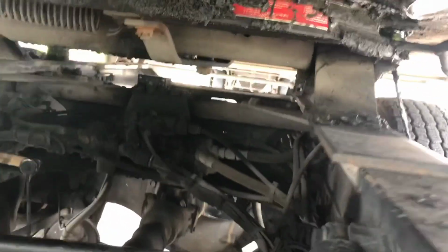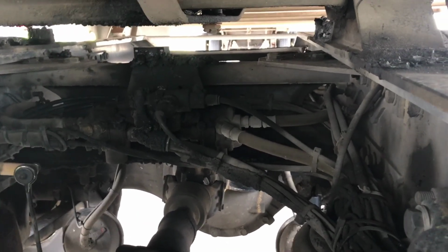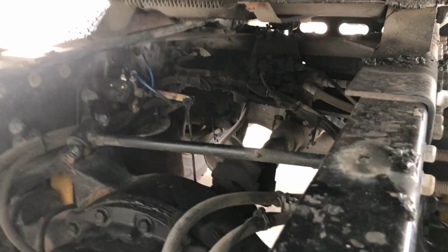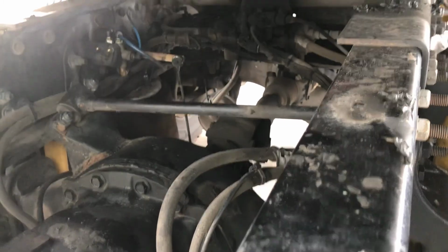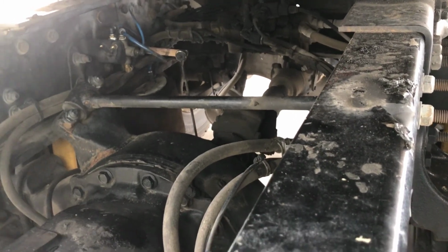This one doesn't have these, but it would be like in this area towards the fifth wheel, like up here. Look for loose or missing lock pins in the slide, fully engaged. Air hose, no cuts, bulges, or abrasions, no leaks. Fifth wheel is positioned properly so that the tractor frame will clear the landing gear during turns.